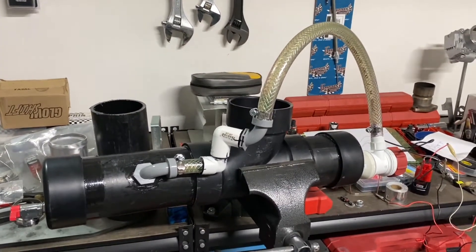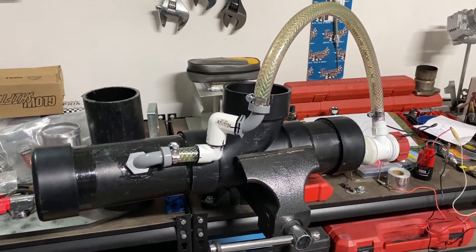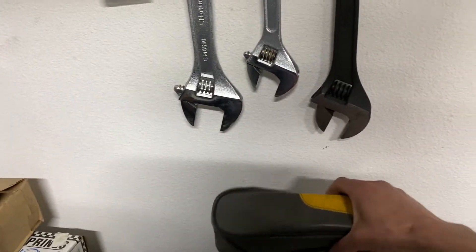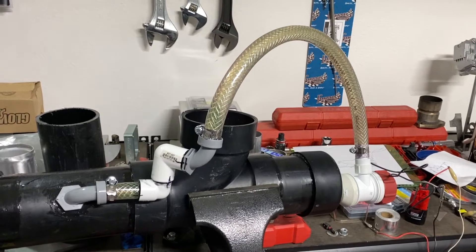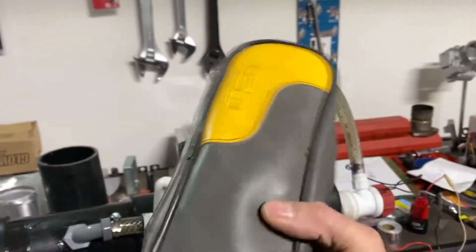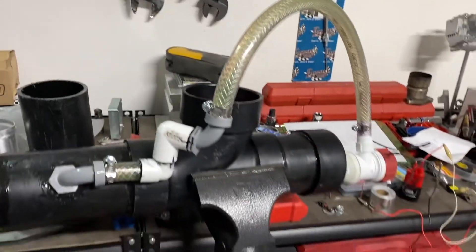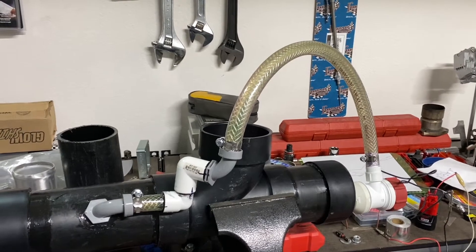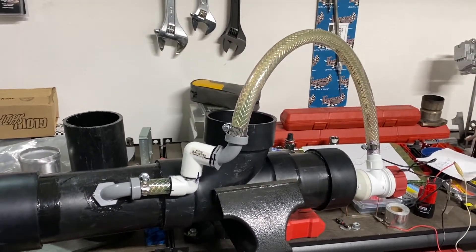I just wanted to show you this little deal in clear view. The next time we visit this, it should be installed on the truck — or we'll install it on the truck and run a little test. What we're going to do is run it, check the air temps from the Diablo. We'll drive it, get it hot, then start circulating it and see if we can see the temps dropping. We should be able to do a standing test using this. It has a thermometer-type deal that we can attach to the side of the intercooler to measure some temperature change — it won't be internal temperature, but external will be fine since the intercooler is designed in a way where it should be fairly closely accurate.